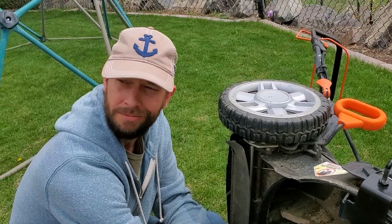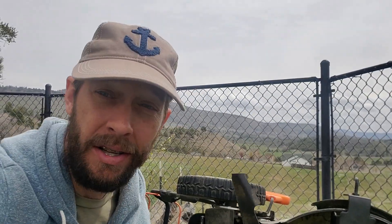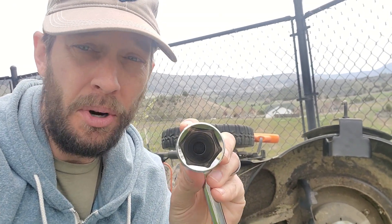That is a lot easier — thank you, you're welcome. My kids obviously keep me in line sometimes. The important thing to take away from this silly little skit is getting your mower blade off in the first place quickly and efficiently — one of the easiest ways to start sharpening your mower blade more regularly. Most of the time the simple act of getting the mower tipped on its side and the blade off is like, 'I don't know where all of the tools are.' Get yourself a shoe box — stick a blade stop in there, find the exact size hex nut for your lawn mower, and stick it in the box.